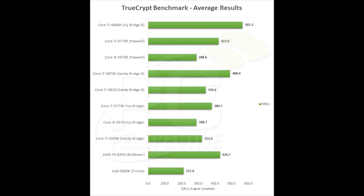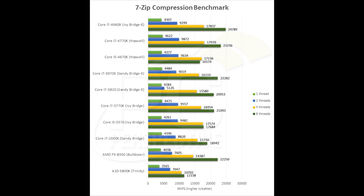There are a couple of other benchmarks showing the performance benefits of a six-core configuration compared to a quad-core configuration. So where do we stand on Ivy Bridge E? It's kind of a mixed result. It's definitely the newest, fastest processor platform you can get in most instances, especially for multi-threaded applications and workloads. There's a lot of overclocking capability, but our sample was only able to reach about 4.3 or 4.4 GHz. We saw some reports of others getting 4.5 or even 4.6 GHz, so our processor sample was on the lower end of that.